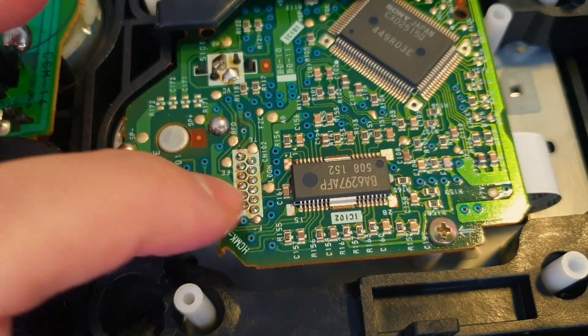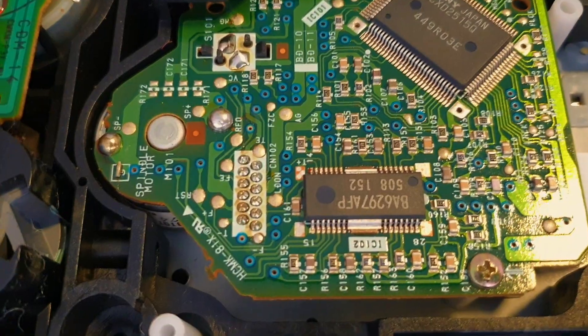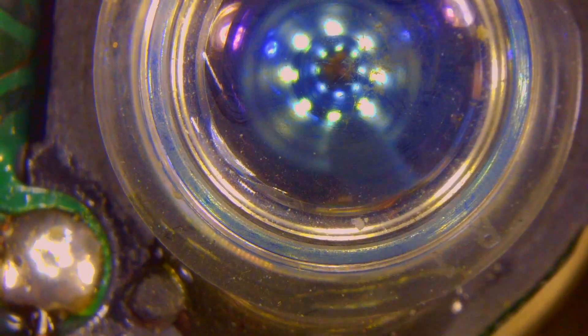I presume this is our problem — the pickup is blind for some reason and the speed control loop is not being engaged properly. Let's look through the pickup lens under the microscope. And oh wow, sure enough, this lens has a thick glaze, which is definitely an issue. A cotton bud with isopropanol should help, but you should hold the lens from below in order not to ruin the focus coil support. There — much better. It also has some scratches on the surface, reminding us about those idiotic cleaning CDs which you should never use, unless you want to ruin your optical pickup intentionally.